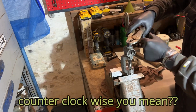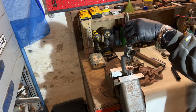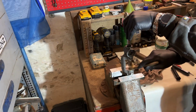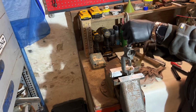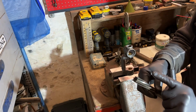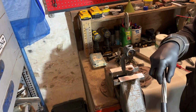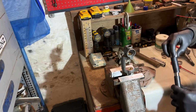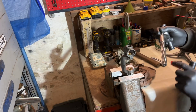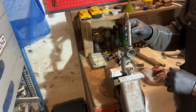And just go backwards when you take it out, and see the shavings here. Just take them out before you go further. One tip, don't drop it. It's hardened steel, and if you chip the tooth, you're done. Can buy another one then. So make sure that it stays oiled in. Okay, it's cleaned up already.